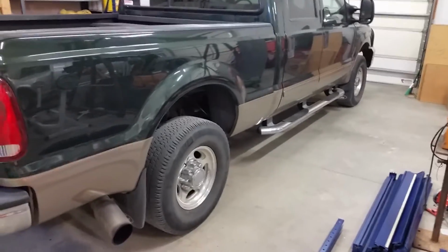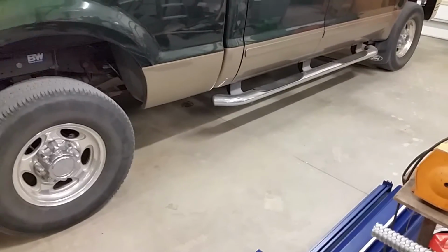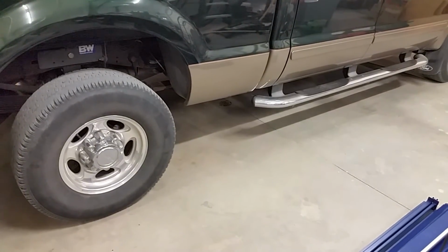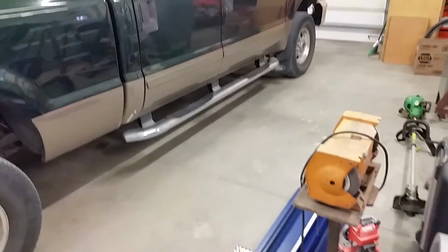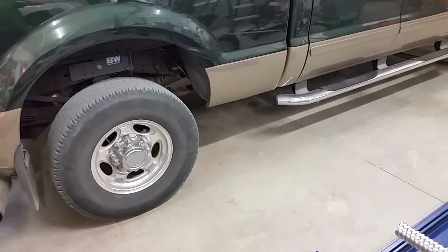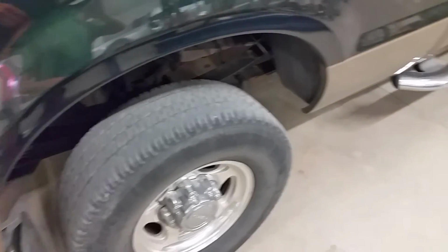So I guess some of that you could say is my fault, that maybe I don't have brand new tires on the pickup, but at the time they still had 6/32nds on them. It's not a lot. Now I'm down to about 3 to 4/32nds. They're not complete racing slicks, but almost 7,000 miles later they're touching the wear bars. So that driveway is just an absolute bear. And a couple weekends ago I ran this thing on the dyno and kind of understand why, with the torque level it's putting out and the lack of torque management that the older pickups have. You're going to need serious traction and not break everything free all the time.